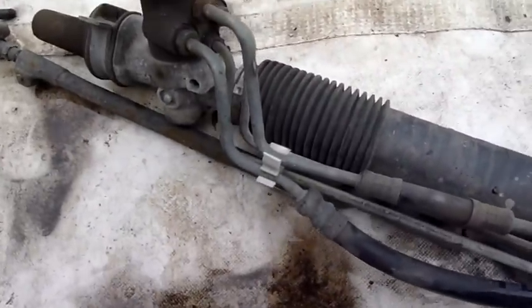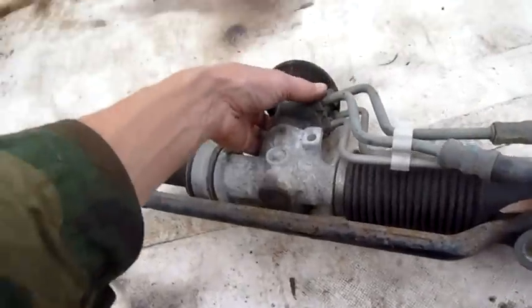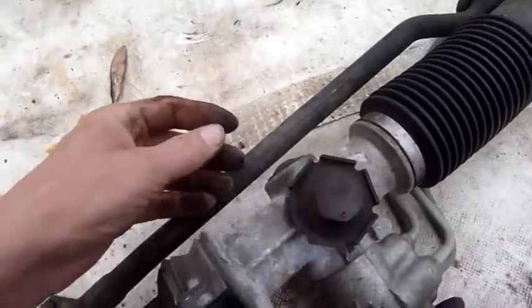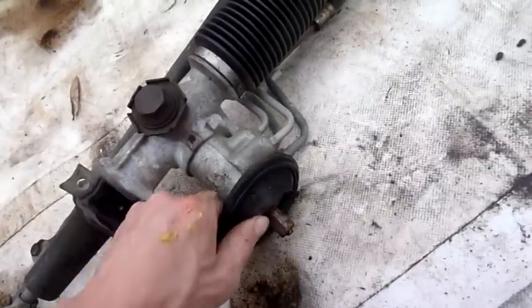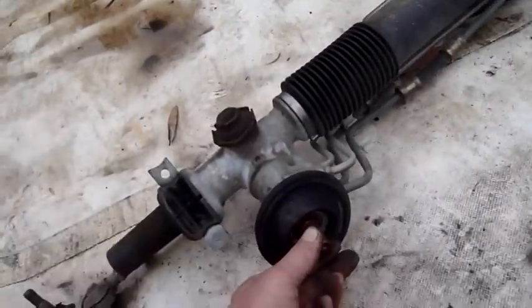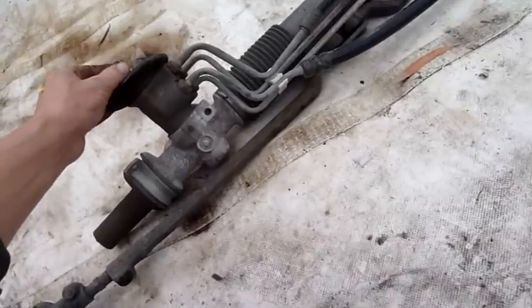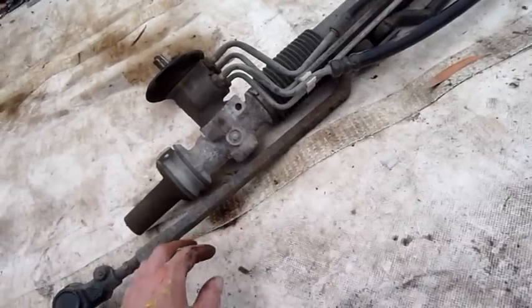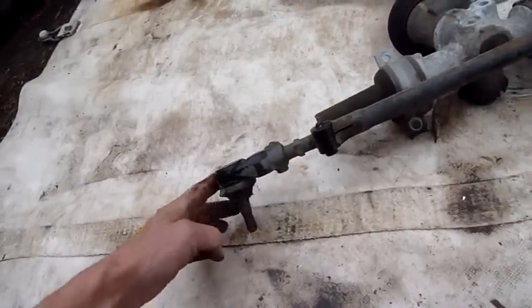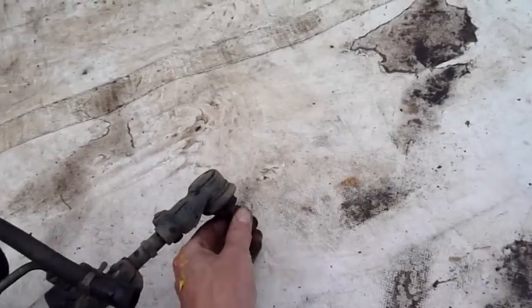It's a neat bit of kit — very, very simple. I think the hydraulic side of it goes as far as this piece here; there's no hydraulics in any other part of it. There's an adjusting nut there. It's incredibly simple rack and pinion power steering, at least I believe it is. Recirculating ball generally has a larger box with a ball nut and screw inside it. I've taken recirculating ball apart before — they're interesting with a little ball nut and lots of little recirculating ball bearings. And those are your tie rod ends — they're a bit floppy and worn, definitely a roadworthy fail. It's all loose and flogged out.